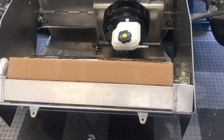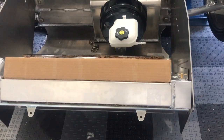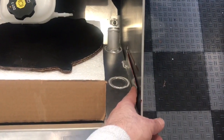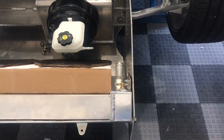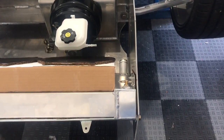In reality, that approach is bare minimal. I'm going to put this fan shroud and attach that to the radiator — and that weighs about 13 pounds. Then I'll attach a condenser, which weighs about a pound or a pound and a half. So I want to modify these brackets to get much better insulation to prevent damage to the radiator based on the vibration going through the chassis.